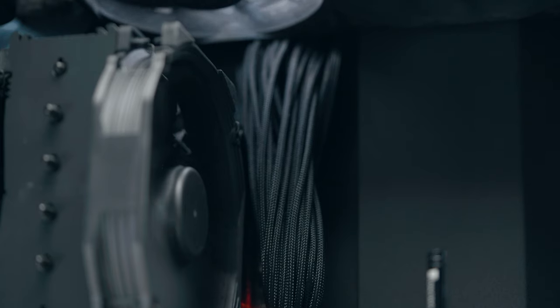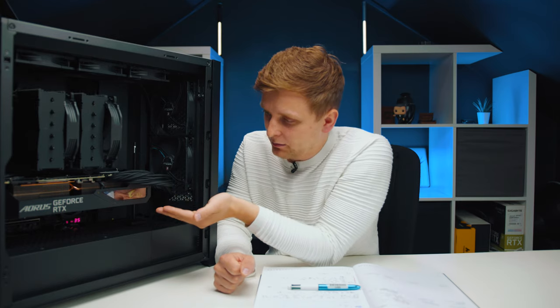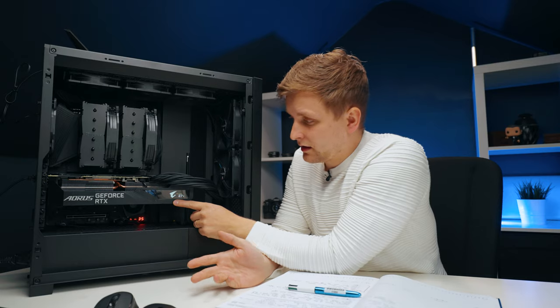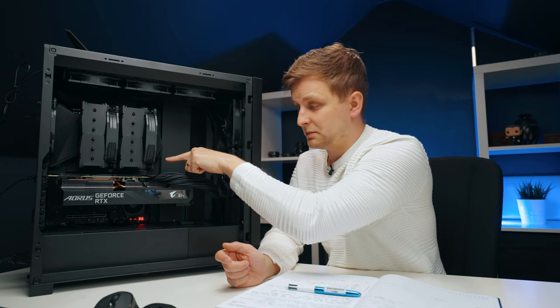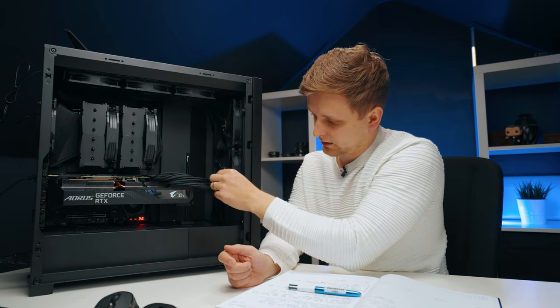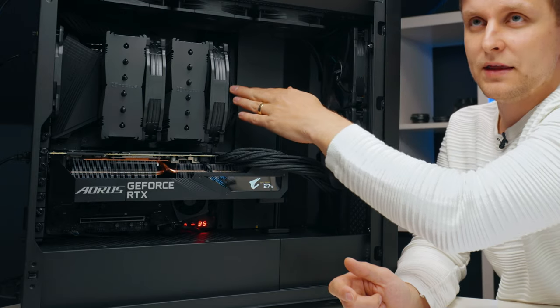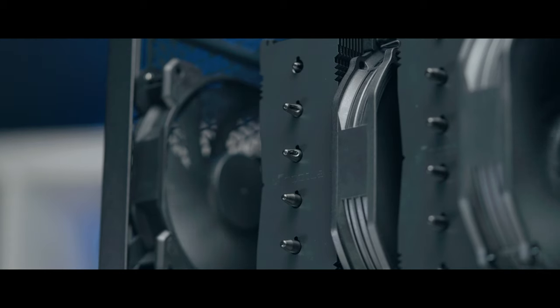That's why the 24-pin ATX and all the fan cables go straight up rather than into the shroud. The GPU cable can't come down into that area either — it would block a good airflow feature — and you can't route it over the top because it would block airflow from the fans to the CPU. So the GPU cable comes to the side and down into the front, which actually looks quite cool. We didn't use any cable combs this time. The 120mm rear exhaust fan pushes out the hot air that the CPU cooler pushes through, and I'm super happy with how that works.